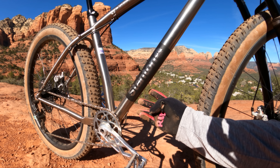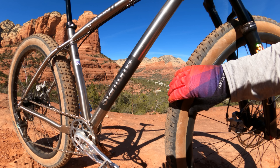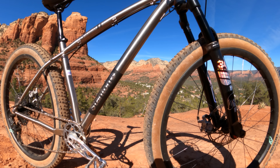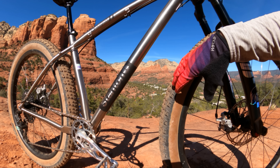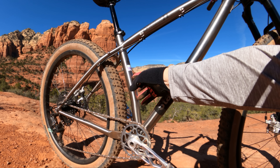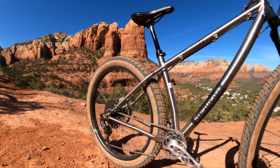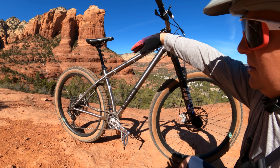One thing I would have liked to see is a three-pack water bottle mount down here. Even if I had a water bottle there, the front tire doesn't leave a whole lot of room to compress in due to that short reach and steep head angle — that really brings the front tire in. I was initially going to take this bikepacking, but when I put my water bottle there with strap-on mounts, the tire was rubbing it. I'd love to see some more mounts in the seat tube that don't protrude with the dropper, and maybe double up top. But I do love that this has rack mounts on the back — I think racks on bikepacking bikes make way more sense than seat bags because I like to use my dropper.